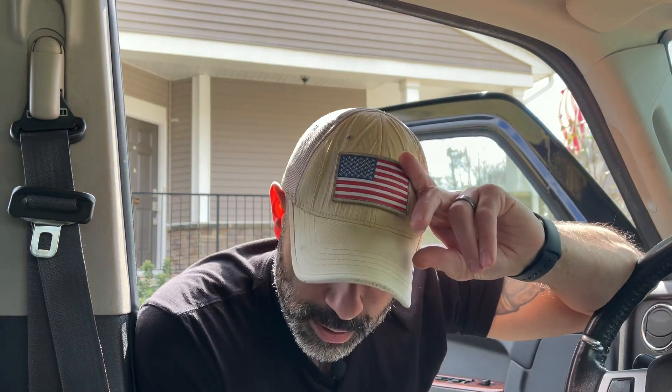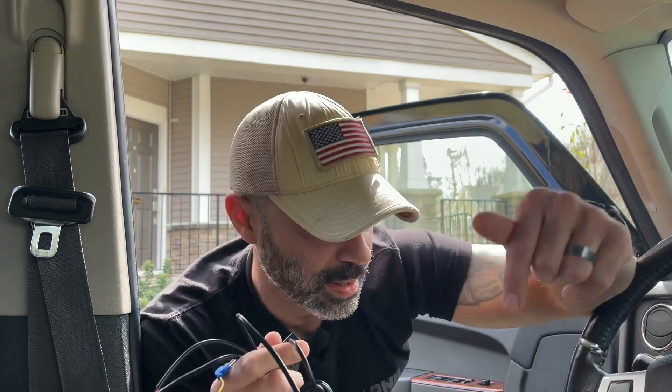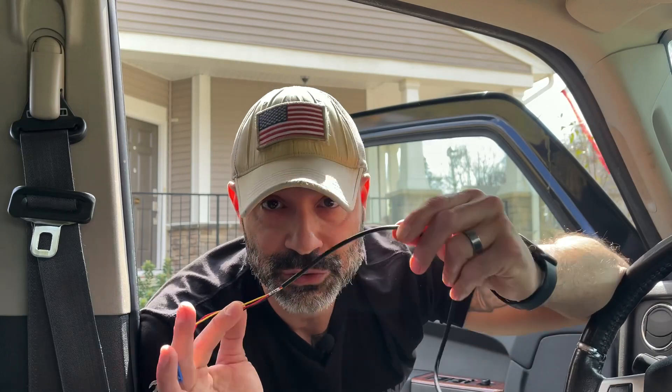First things first, let's start testing. I had to go online and check what fuses are spares and what needs to go where, because these fuses right here are blue, which means they're 15-amp fuses. I need to find a slot that will take these. The Commander has three fuse boxes — two in the engine bay and one underneath the dashboard inside on the driver's side. I would love to keep it underneath the dashboard inside the box right here.